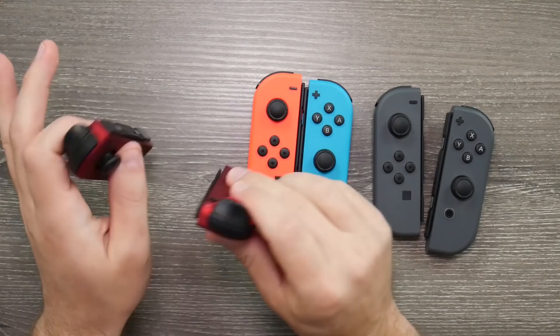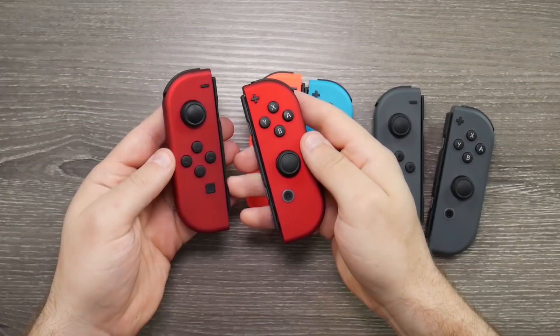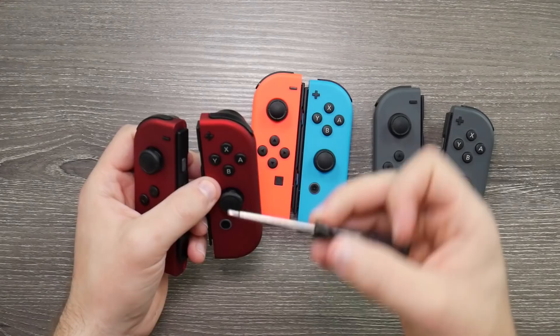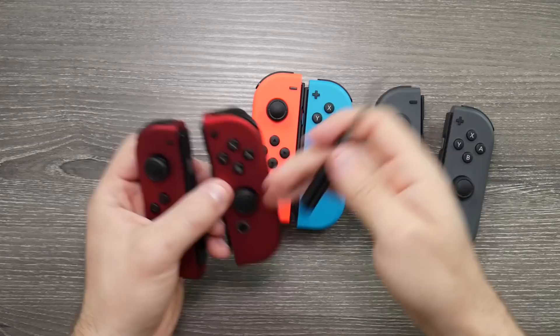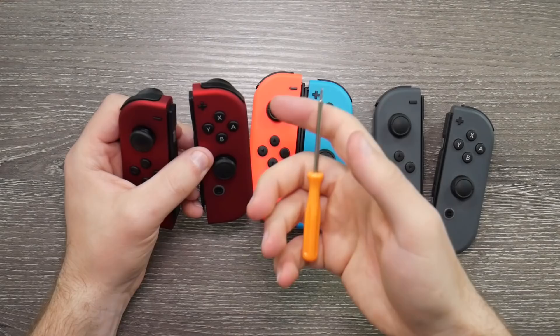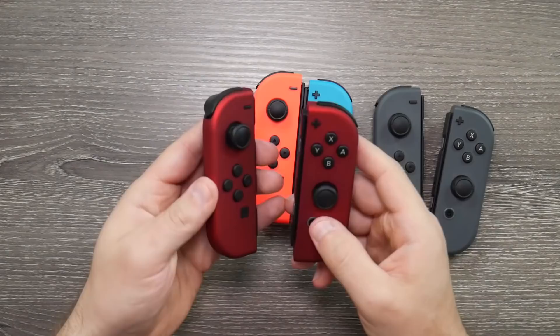I would recommend at least getting some thin tweezers — that'll help with the ribbon cables that are hard to reach, maybe even curved head tweezers. That's the one accessory I'd recommend. The drivers are okay, but the tri-tip part is a little too sharp and might strip some screws too easily. I'd actually recommend looking into a larger size tri-tip driver — you're going to use it a lot if you change out Joy-Con shells. The Phillips head worked a bit better. I'd still get a more precise one that'll last forever. These are cheap — they're not hard to find. You can get a full kit for like 10 or 15 bucks from Amazon.